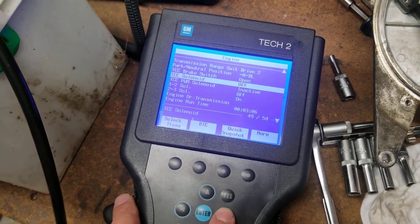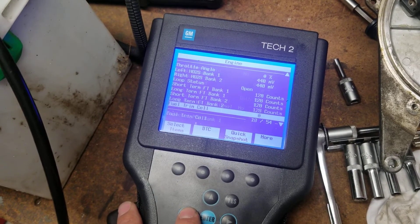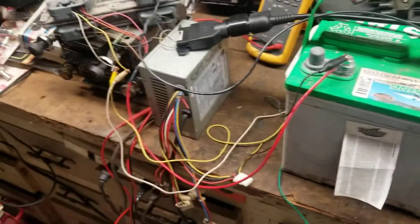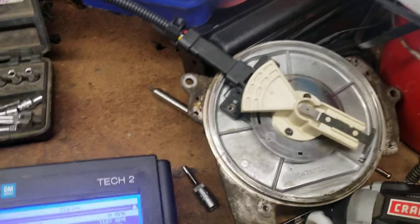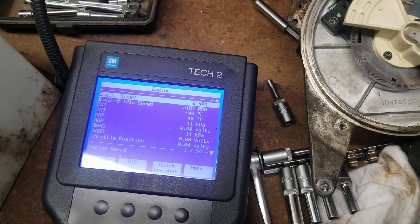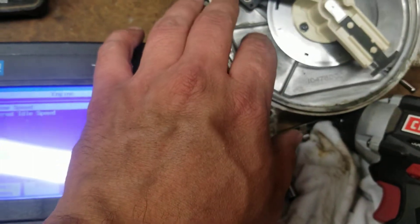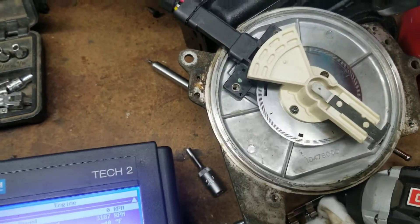You can sift through all the faults in here — anyways, that's a pretty basic way of testing it. I'm going to end up trying the sensor on the car and I think it'll be okay. I've got a Roadmaster now with an aftermarket opti in it that constantly throws codes, so I'm just going to take that opti apart and stick that sensor in it. The used OptiSpark I bought — someone screwed with it and the disc holes in the middle are all worn down, so you can't time it correctly. I'll salvage some parts and get that going.